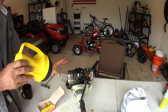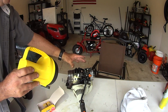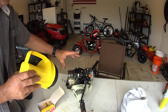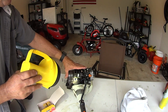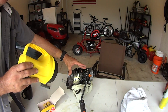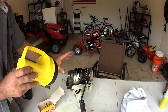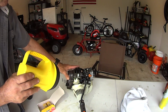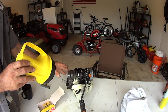People have gotten kind of ignorant on my channel, saying I don't know what I'm talking about when I refer to these as four mix. They say there's no such thing as a four mix. It's either a four stroke or a two stroke. No, they call these a four mix because it's a four stroke that uses two cycle mix. So it's a four mix. If I refer to this as a four stroke, and I tell somebody, hey, go grab the four-stroke, then they're going to be looking for the oil dipstick. You see? It's not a four-stroke. It's a four-mix. It operates exactly like a four-stroke engine, valves and all, but the oil lubricates by way of the two-stroke mix. So it's very important to use good lubrication, good oil in here.